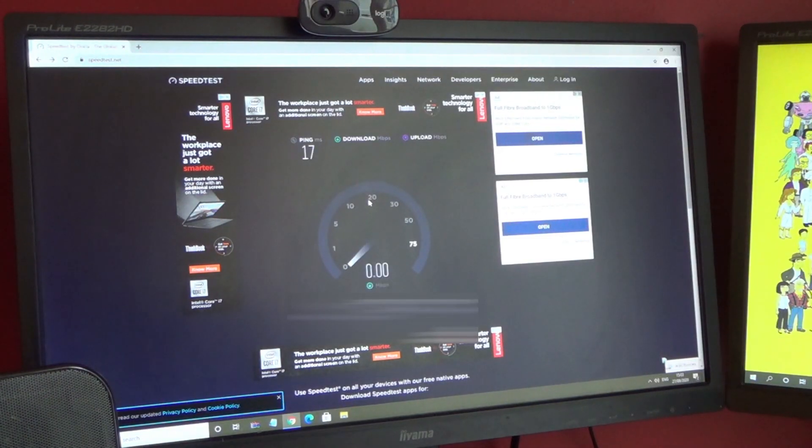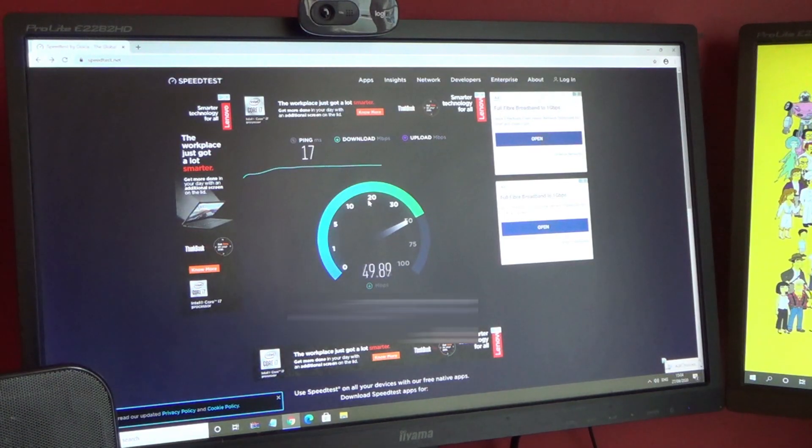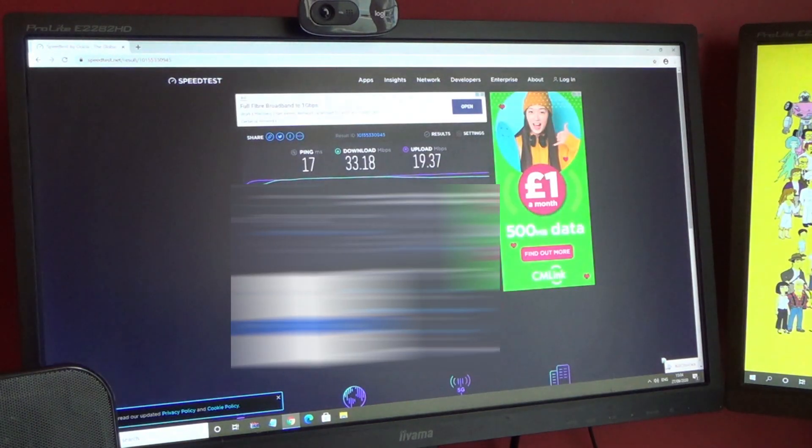Now we're under the stairs and it's all set up — five lights for the signal. Hopefully this will give the most stable connection, if not necessarily the quickest. The ethernet is connected as well, and the two aerial cables from X and Y are screwed in behind the blanking plate. If you're thinking about mobile broadband as a cheaper option away from cable or fibre broadband, I personally wouldn't — those will give you a better connection. But a lot of people haven't got that choice, and mobile broadband will definitely give you a usable service depending on your network provider and area. Remember, every device previously on Wi-Fi will need to be updated with the new SSID and password. Please give it a thumbs up and subscribe for more how-to videos.